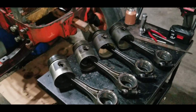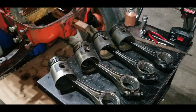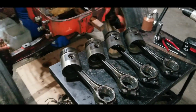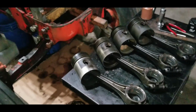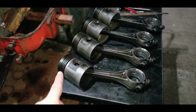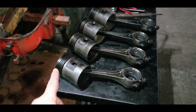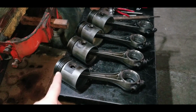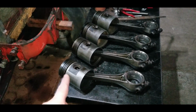Through Case itself, it was hard to find, but at a horrendous price. So unfortunately, they're going aftermarket, which is okay. They're all spec'd out the exact same. The top ring is a little bit different, with a different angle on the pitch, I guess the sweep you'd call it. And then there are 2 more compression rings, and there'll be a 2-piece oil ring.